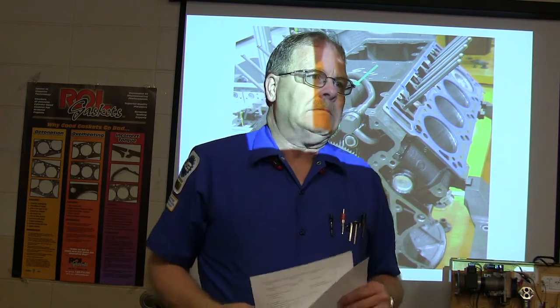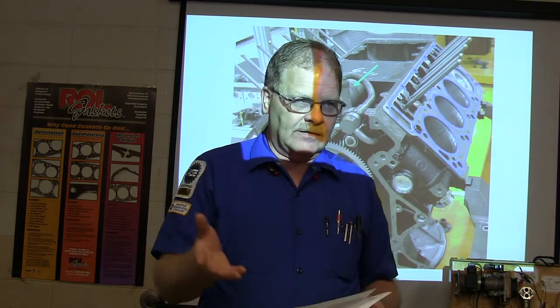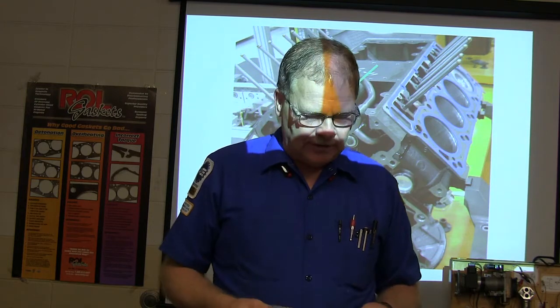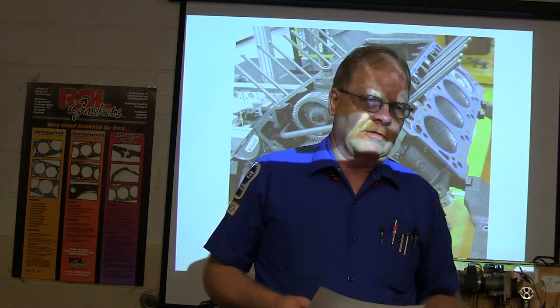If you don't see it, just estimate. Don't go by the max pressure, but estimate, the weight of the vehicle, all that. You can usually go 35 pounds if it's a pickup or something, unless it's an oddball size. Or if it's low profile, it's going to be different.